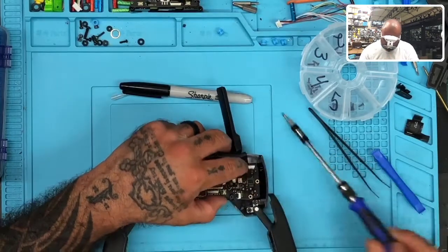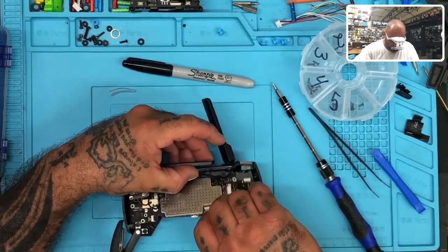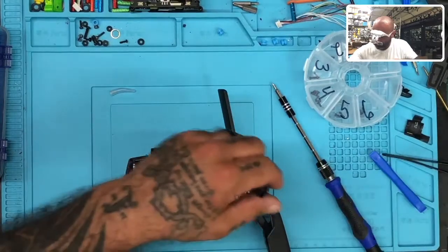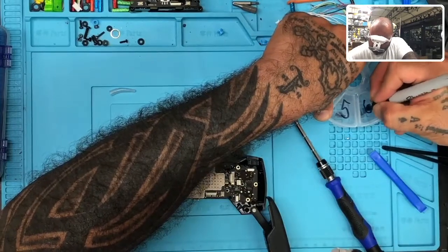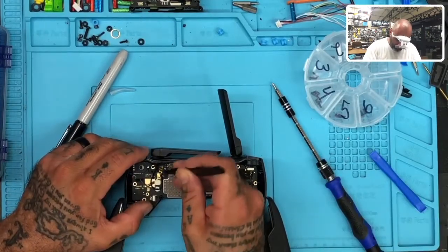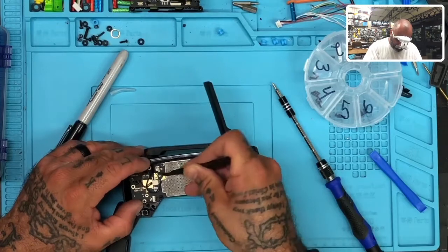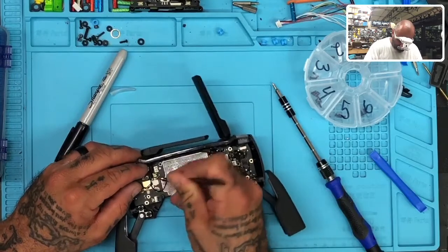A little alcohol wipe should do it. We're going to remove the two antennas first. Remember — put it back in the same order. Make sure your closest antenna goes to the top of the frame, farthest antenna goes to the one farthest from the top of the frame. This should be an easy way to remember it. Just use your tweezers to pry it and lift it up. The only other thing is we're going to remove our plug here — that's for the control for our dial.